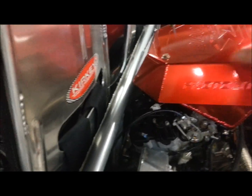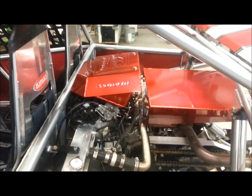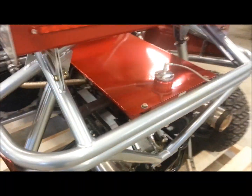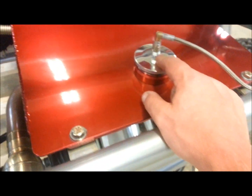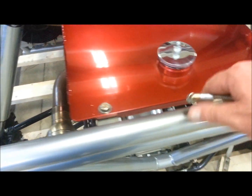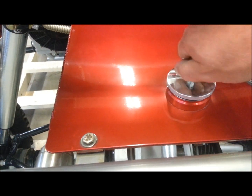Got a custom air cleaner here. This cover comes off and below that there'll be a pre-filter and an air filter which can be replaced and checked. Radiator, fuel cell, fuel pump. There is a breather ball in here for tip-over — we've run it without and had some gas splash out once in a while, so we recently added this, which if a little gas goes past the tip-over breather ball, it'll just direct it over here instead of down the back of the buggy.